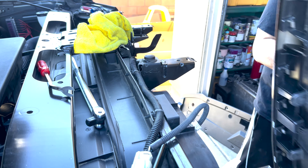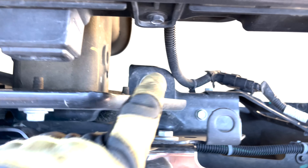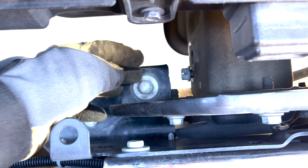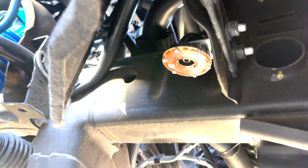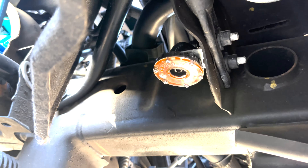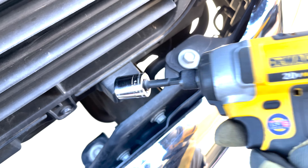Actually came out better than the first one. The bolts we're going to take are this guy right here, that one down there, and the adjacent ones like this one. There are a couple other bolts here underneath. Now the new bumper is a high-clearance one, so I'm thinking we're going to have to remove this support bar because it's going to be sticking out all weird looking. These require an 18-millimeter socket.